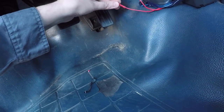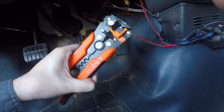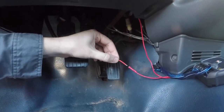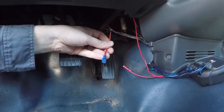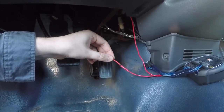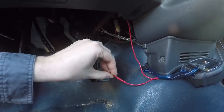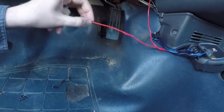A lot of people like to solder, which is probably the way to go, but on something that kind of moves around a little bit I like to use butt connectors. Just put the little guy in there, crimp it up and you're good to go. Slide it on there, use the inside of the crimper to crimp that guy, squeeze it up. Got that side crimped on there — give it a little tug, nice and good. Now the other end — this side plugs into the original O2 sensor back to the ECU.